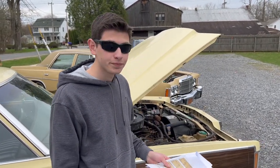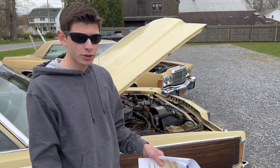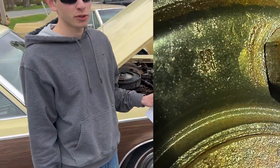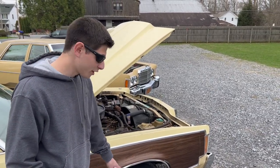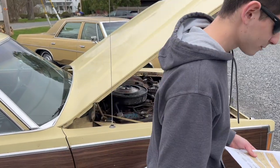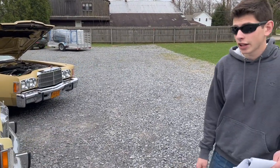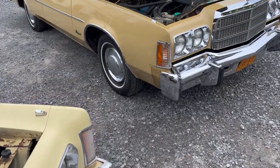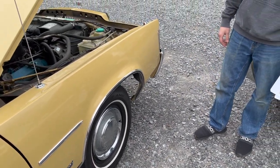We were told something unique about these rims — they're H-code wheels, the heavy duty wheels. If the hubcap was off they're actually stamped with an 'H.' But don't confuse them with the ones on the '68–'70 Road Runners and Coronets — they're not the same. These still have to be worth good money because they are heavy duty rims, and you've got five of them including the spare. The Newport's wheels are not stamped and have the smaller tires — you can really tell if you stand back.